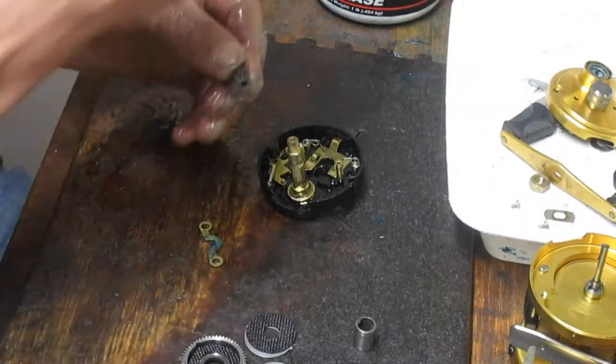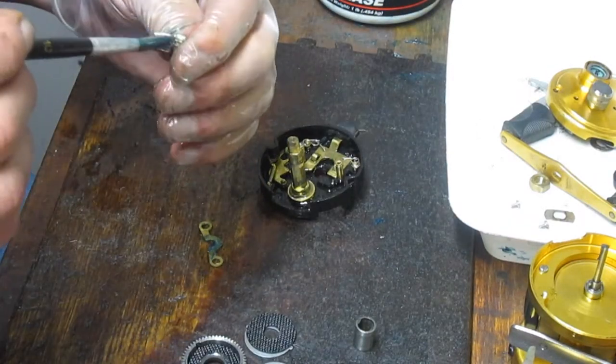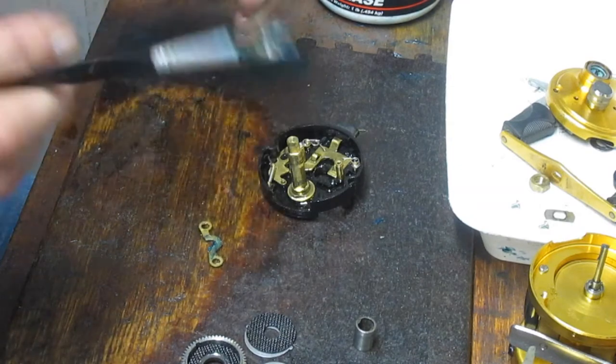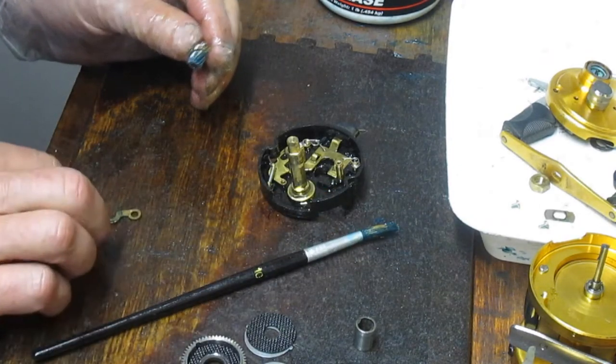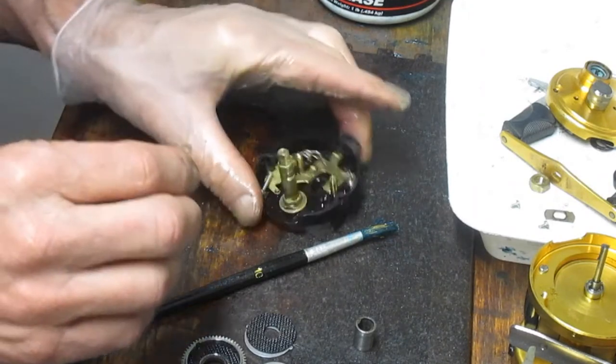While we're at it, I'm checking the teeth, making sure that the spool gear teeth are good. Pinion gear — I use those terms interchangeably — they're fine. I'm going to take this and put the yoke back on after we've lubricated it, loading it onto the two posts, remembering that we have springs that still have to go on there.